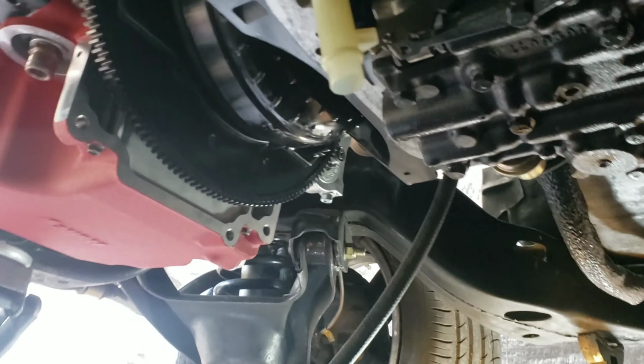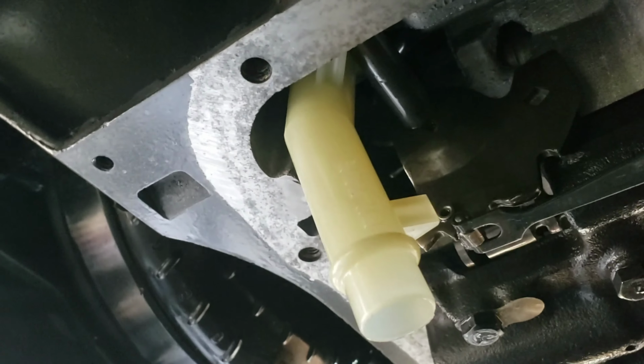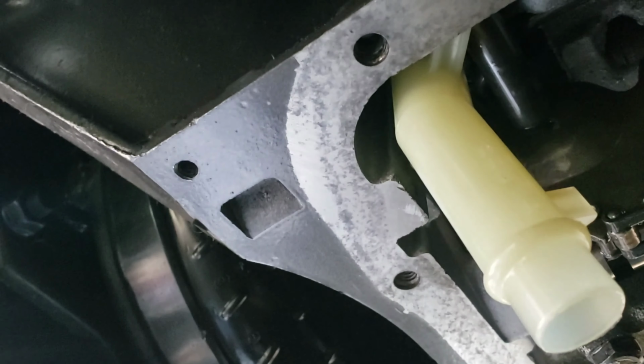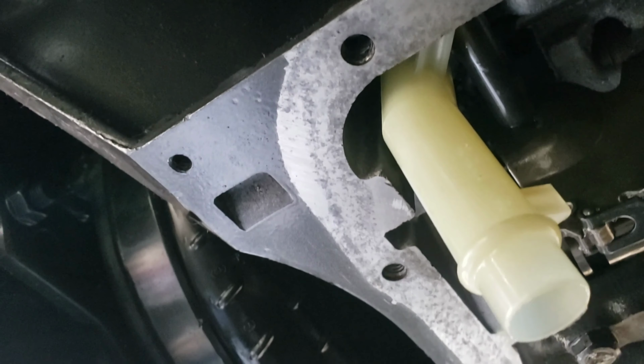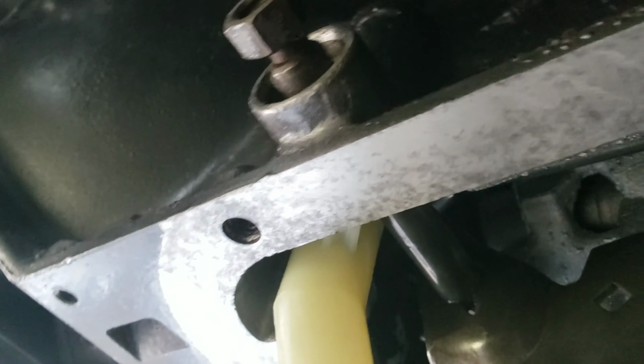Okay, so this is it. So you got to change the filter tube. When I pulled my old one out, it had 2 gaskets on it. So don't be that guy, which I for sure did that. So it's my fault. You got to stick your finger up in that hole and pull the gasket out. You'll feel the lip, and you probably won't feel the gasket, but once you pull it out, you'll see it on your finger. So that's just a tube. It tells you which side is filter, and then the other one says case.